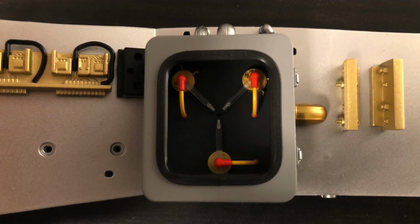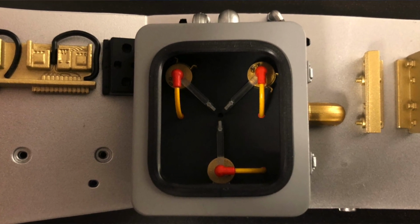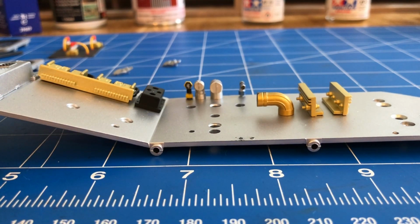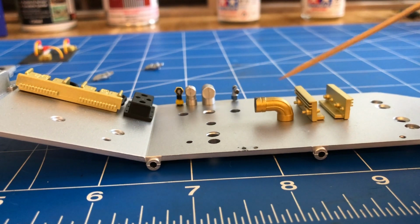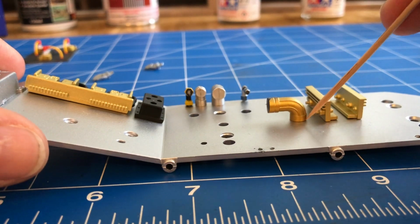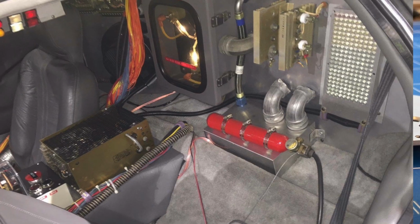By now it's ready using the stock pipes, and I think it will look really nice. So now I want to tell you something about this pipe. Joe also mentioned in his video that this pipe is actually wrong, and it's wrong not only color-wise, because it should be silver or actually galvanized steel color, but because it has a longer side and a shorter side, and the shorter side should be against the flux and not the longer side.